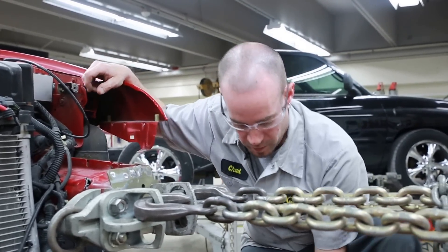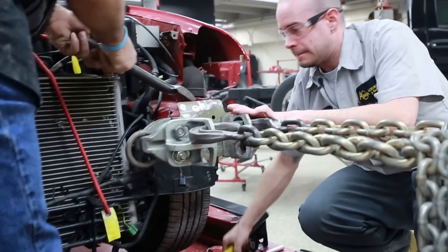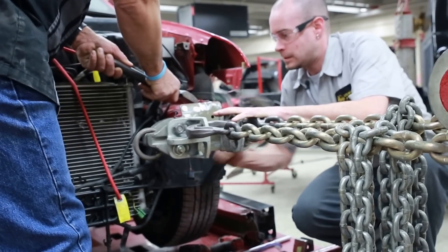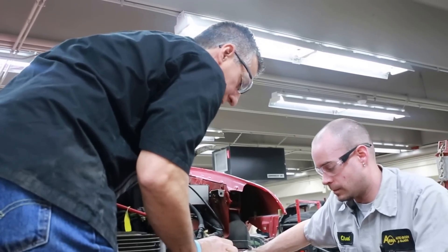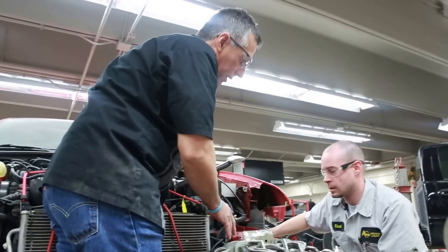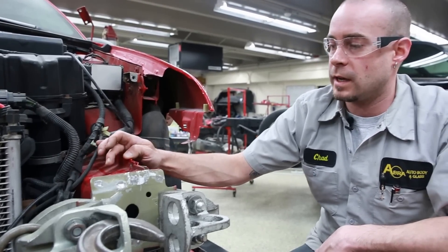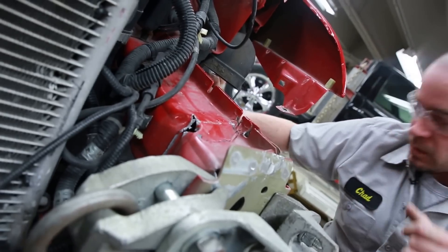I'm just trying to relieve this stress and move the metal where I want it. We're concerned with over-pulling on it, so I think we're going to stop and re-grab onto the rail in a different location. Once you over-pull it and distort the rail, we've got an issue. We're going to cut the outside cap off this rail — just a piece of sheet steel, high-strength steel — so we can get inside and make proper welds and get this metal straight again. We'll drill out these spot welds, cut it at a seam, and section it out.